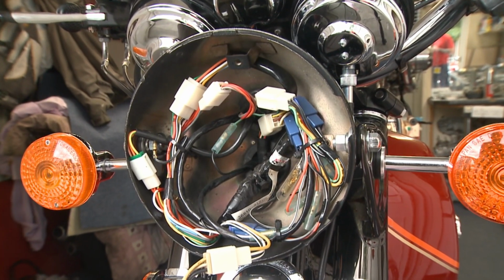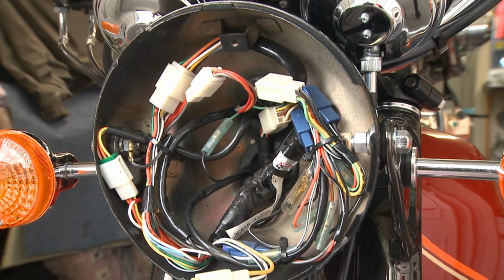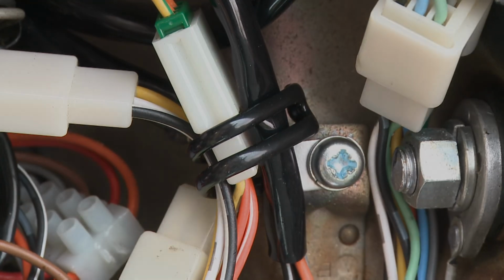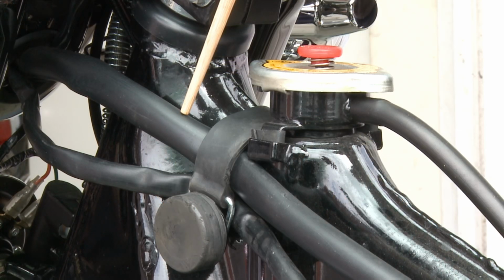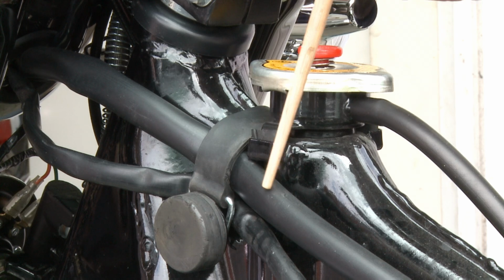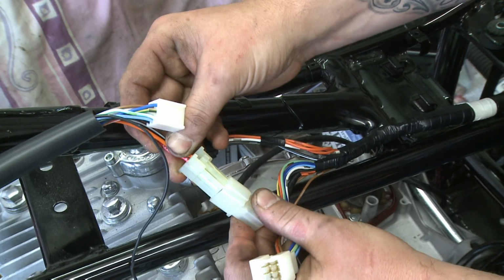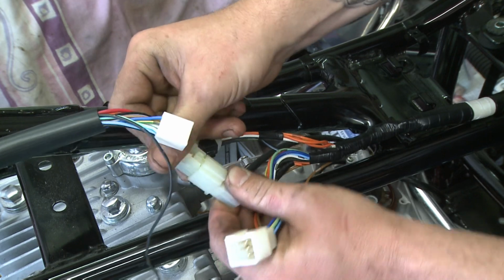Place the wires around the outside of the rim to make space for the lamp assembly and fit harness clamps as shown here. Note the correct route for the front wiring loom and the digital gear indicator loom running below. The front and rear looms can now be joined, making sure of a firm fit.